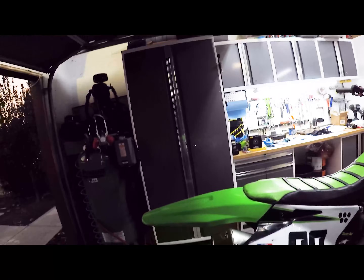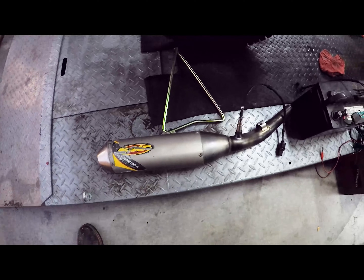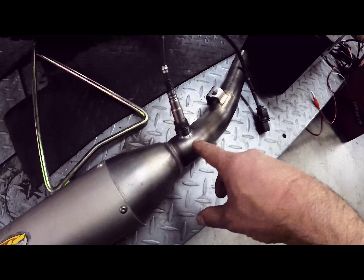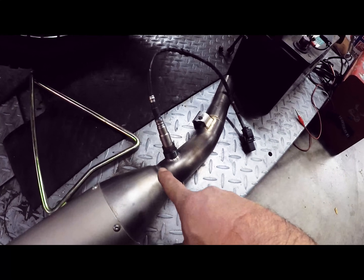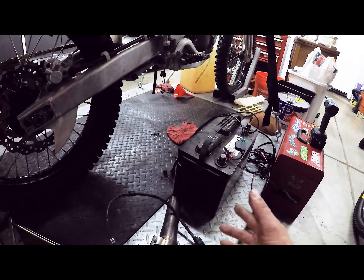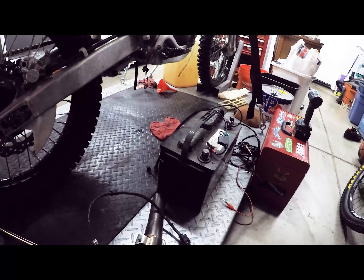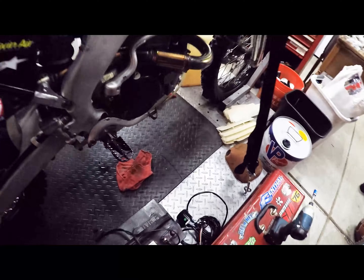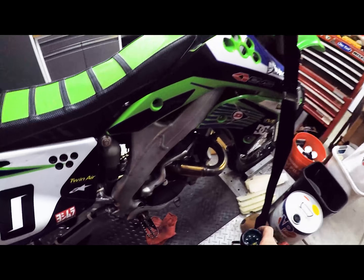You could basically give it full throttle right off idle and it would just die, fall on its face. I put the other pipe back on — the FMF PowerCore 4 — which is the pipe being sold with the bike. I also want to give a shout-out to Jared Brown over at A1 Fab and Welding here in Sacramento for welding up the bung for my O2 sensor. I still need to come up with a better power supply system — that's a huge battery I have, usually in my boat, but since it's wintertime that's out. All in all, I'm impressed with this AEM air fuel ratio sensor, so I'll put a link to that in the description.